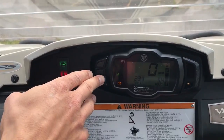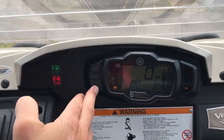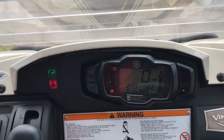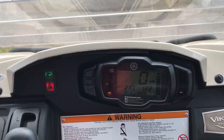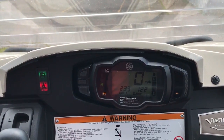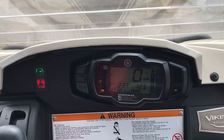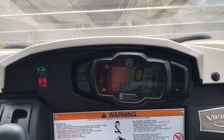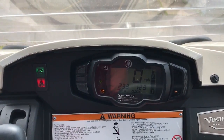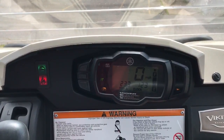Looking at the gauge cluster, we have two trip meters — Trip A and Trip B — so you can use one for the day to keep track of your gas. You can also see a clock and your hours on the machine, plus the speedometer, so if you are going down the side of the road and need to stay under 25 miles per hour, you can actually know if you are going 25. We have the gas gauge on there too. Going down the trail at around 30 to 40 miles per hour, it seems to be using around a quarter tank of gas for every 35 miles, so roughly 140 miles per full tank with the 9.7-gallon tank.